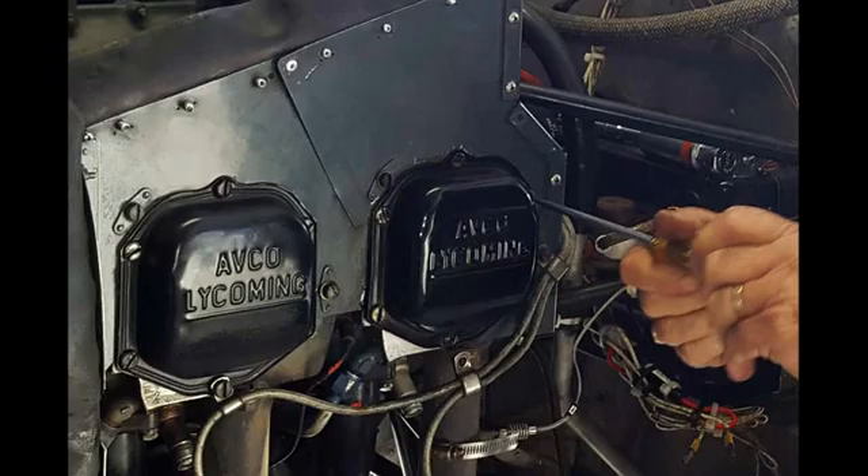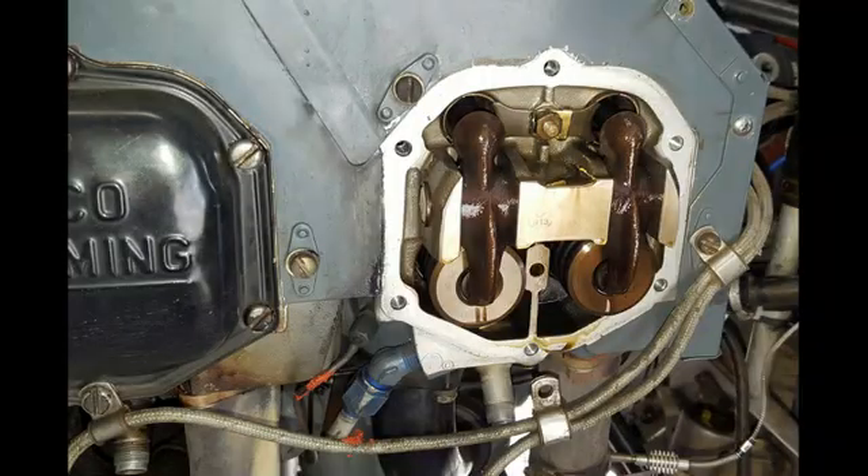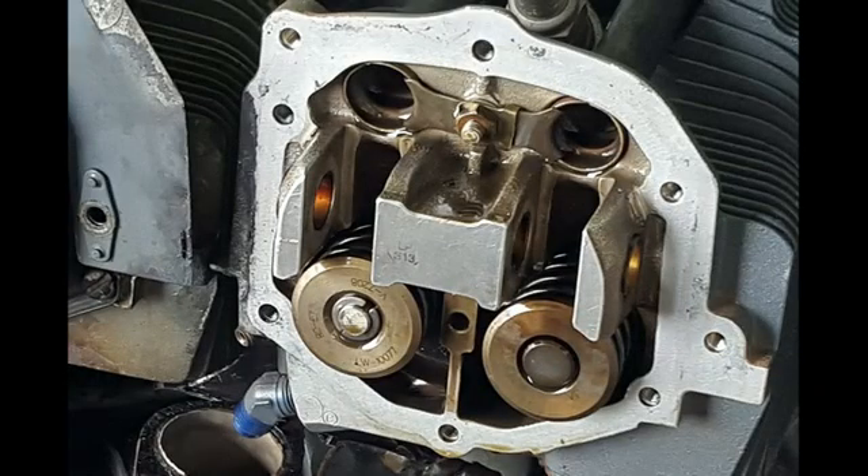The first order of the day is to take off the rocker covers — the black covers you see here — and that gives us access to the rocker arms and, underneath that, the valves and the pushrods, and eventually the cylinder itself. Here are the rocker arms now uncovered; that's the bronze-shaped items that you see in the photo. Now with the rocker arms removed, the two holes above are the tubes which house the pushrods leading up to the valves, and below you see the valve springs.